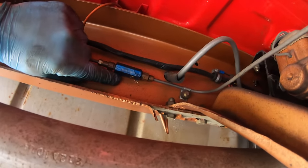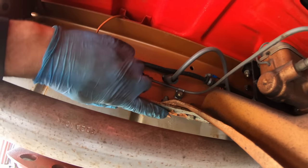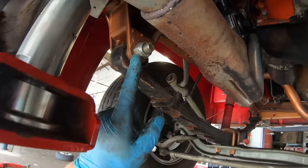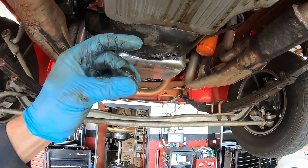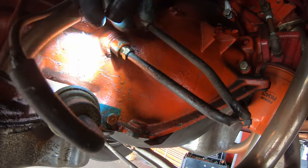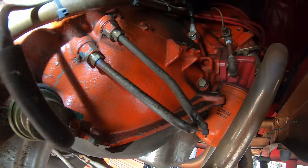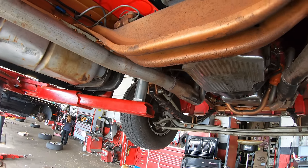And then this valve is leaking up here too, some brake fluid. You can see that it's been eating the paint off the frame. Here's that bolt I put in before. So pretty good oil leak, and it seemed like a trans leak up here too, but I think it might even just be this guy's flare connections on here, because you could see that goes in on an angle. So I'm gonna try tightening that up. That is the underbody. Fuel leak, brake leaks, those gotta be taken care of.